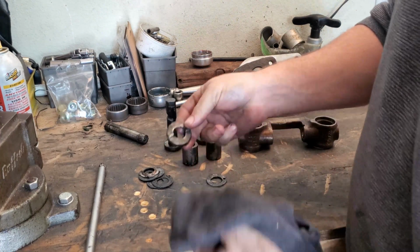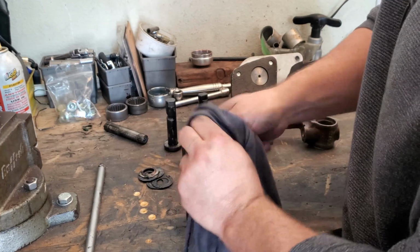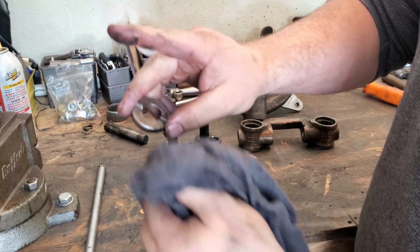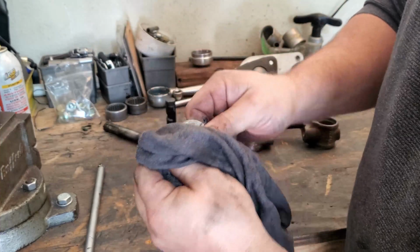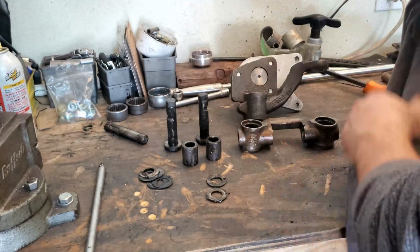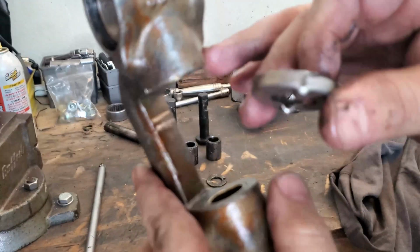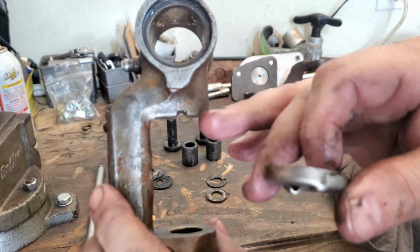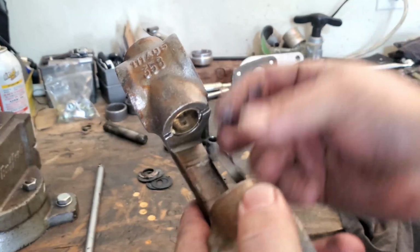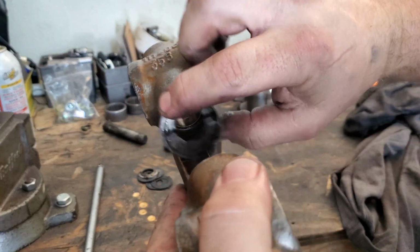And then you have a guide, a washer guide, your thrust washer guide. I'm not sure on the actual name of this thing, but this is what allows it to guide into the grooves at the top of the spindle. And that's how you know you're at the top, because for one, there's a groove. You know the groove I just told you that you have to notch out? There's a groove right there. And then this guide washer will guide everything right into there.